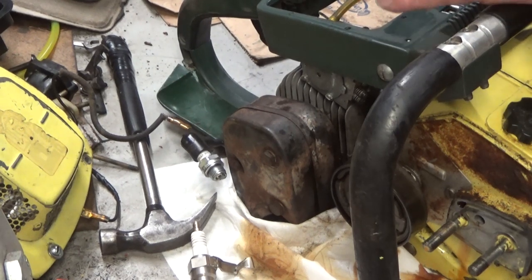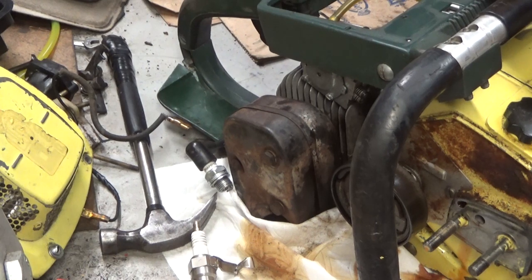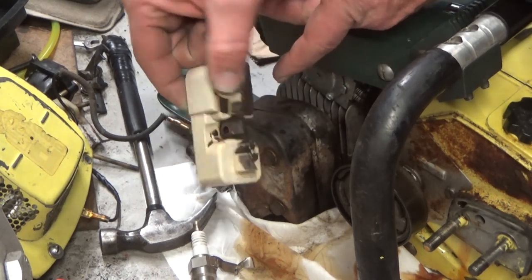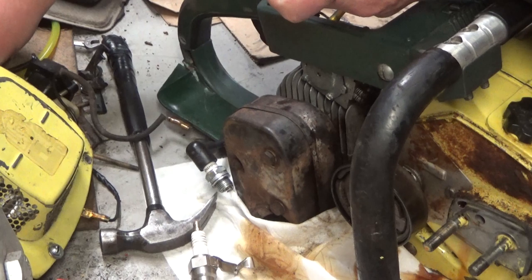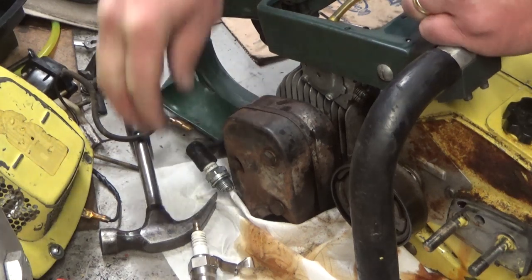So, I really thought this Pioneer P-51 was going to be a super simple fix. Boy, was I wrong. I think I finally figured out what's going on, and I have a replacement part on the way, but I'll tell you what was up. I got the thing, said it had no spark. Here's the original coil, just like a Homelite 410. Man, piece of cake. I got a couple of these used coils laying around that I've been saving. Well, two used coils and a NOS one later to test, I still couldn't get more than a thready little pile of crap spark out of this saw.